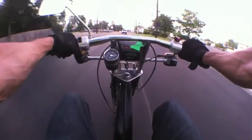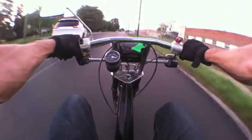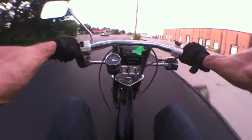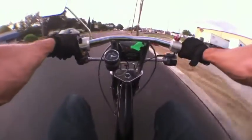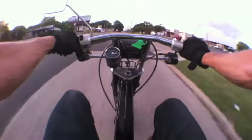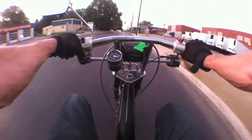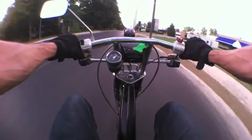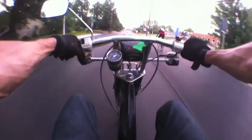To those of you requesting the Urban Express videos — I took a break from the Townie project and the Yamaha hopper I'm working on to get this thing out and run it. Right here I'm cruising about 38–39. I think I had to let up from full throttle because it was four-stroking — kind of hard to hear with this exhaust. I can definitely go with the lower main jet, and the bogging at takeoff is probably more a function of the belt than the carb. I've included a little more riding time so you can hear it in its true glory. Until next time, ride safe.